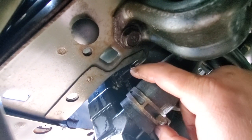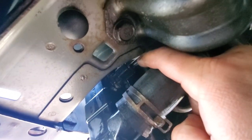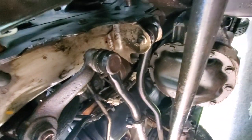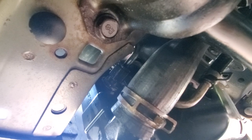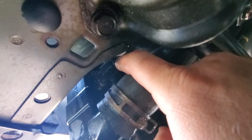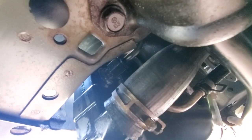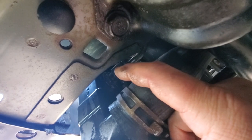Here we are under the front of the Jeep. Here is your lower radiator hose and here is that transmission line — the one that is leaking. We've got a whole bunch of trans fluid sprayed everywhere during the hour ride home. What a mess. I think there is some trans fluid left in the vehicle but I won't know for sure until we top it off. This line is shot — I'm just going to bypass it out of the equation. Should have just gotten a new one, but now I know better. We're going to hook up the new trans cooler and bypass the radiator trans cooler.